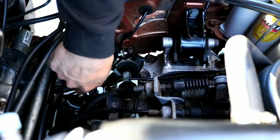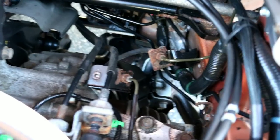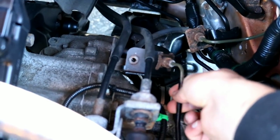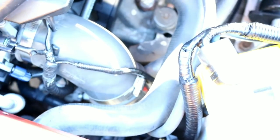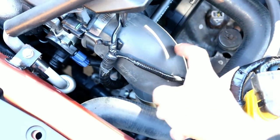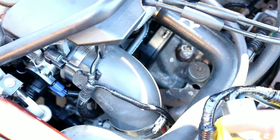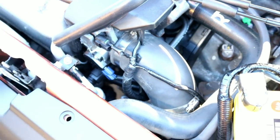We got all the brackets loose — that one and the one from the transmission. This end is loose. Following it up to the front of the car, you'll lift off with the slave cylinder. To get to it, we need to remove this elbow right here — it's only a flat head — and then we can access the slave cylinder.